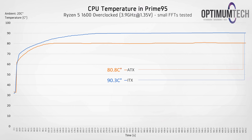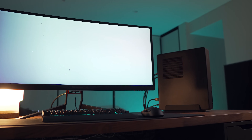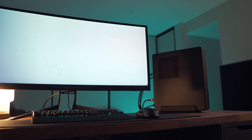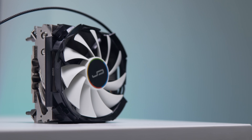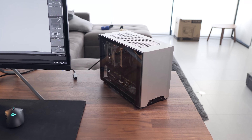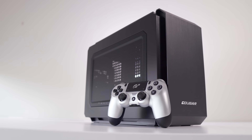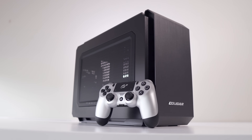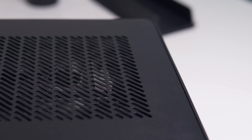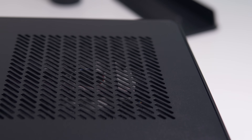That's a pretty massive difference, and definitely a heads up for those planning to downsize while also running an overclocked CPU through intensive programs. It's not really recommended with a low-profile cooler. For those users, I'd definitely recommend getting a wider ITX case like the NCASE M1, Silverstone SG13, or Cougar QBX, which can all facilitate very powerful CPU coolers and handle these overclocks no problem. For slim cases, significant overclocking in stressful scenarios is just not going to work well.